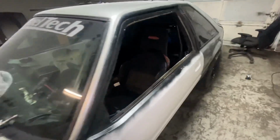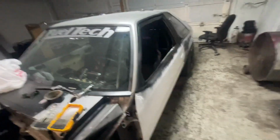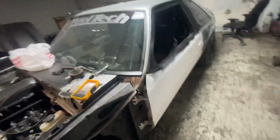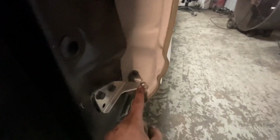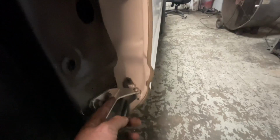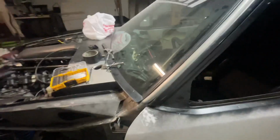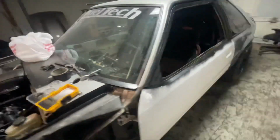Now I'm gonna sand the door down, get it ready for paint. Now that we have the door aligned, shutting right, sealed off, we'll stick the fender back on it. And I'll just show y'all on these hinges right here. If you don't want to make it removable, like on your patch door, if you take this hinge right here and barely cock it up, it'll lock that to where nobody can pull the door off, if you're worried about somebody pulling it loose, knocking the paint off and stuff.